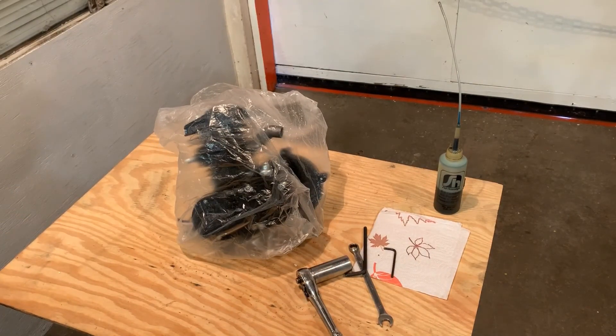You know your cylinder is lubed, which will keep problems down — cylinders scratching and galling on the initial startup. Hopefully that should help anybody avoid problems, because we want you to fire this up from the start, enjoy your bike, and not have any issues from skipping a step here and there.